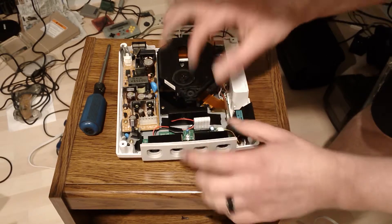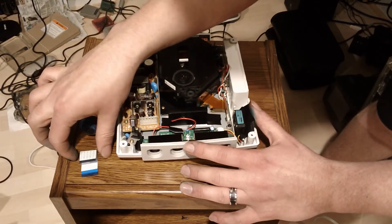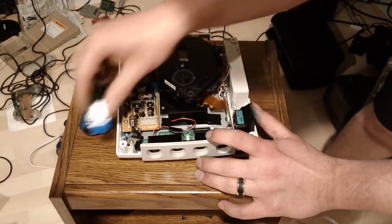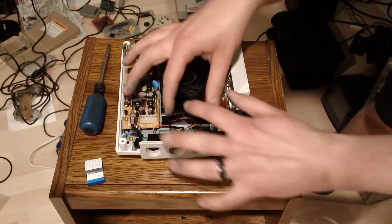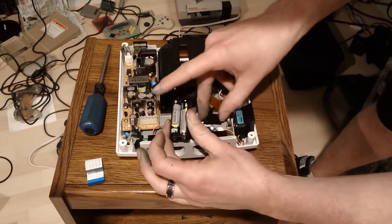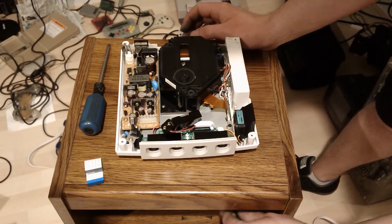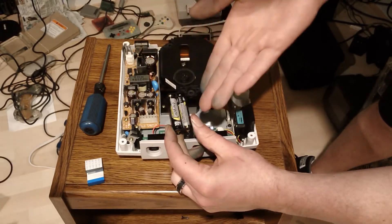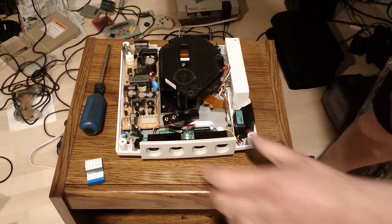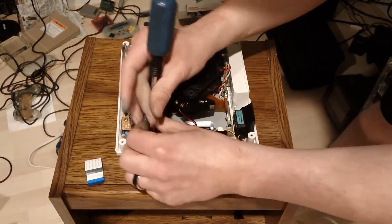Now what you want to do is detach this ribbon cable — there's no sort of latch, it just pulls right out. You don't have to remember the orientation because these are old enough that the form will have stayed on there. What you don't want to do is what I did — put a few AAAs in there. While that will work, the Dreamcast actually outputs a charge to charge a battery. If you don't have a rechargeable battery, which AAAs are not, you don't want to charge something that's not chargeable. It can explode, and it gets a mess everywhere and can short all sorts of stuff.